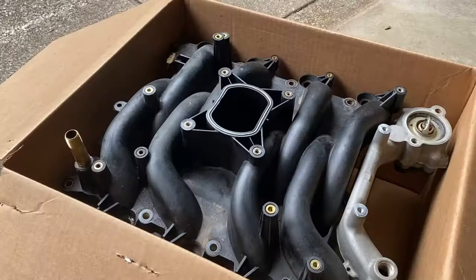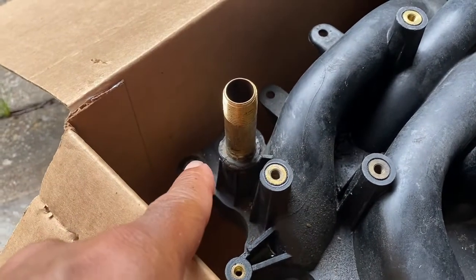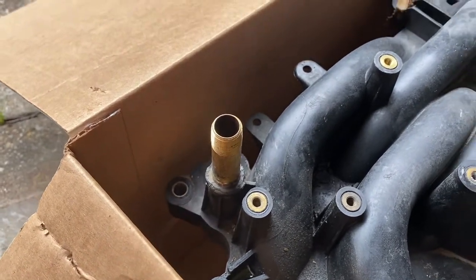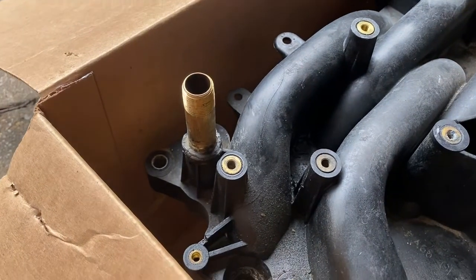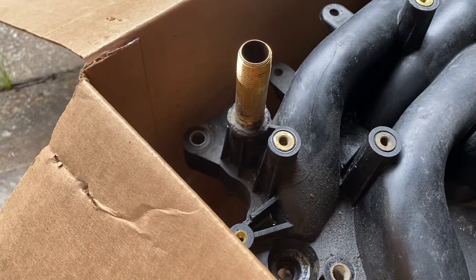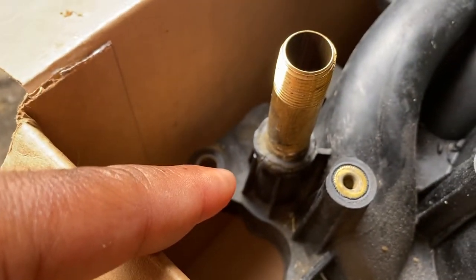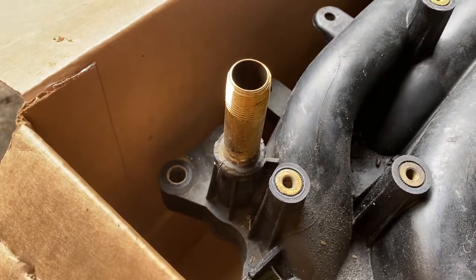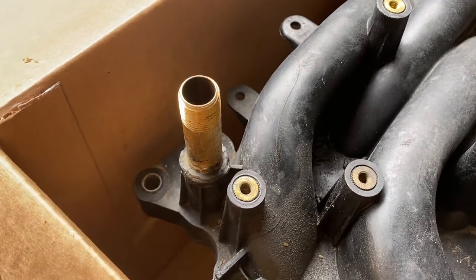I'm going to show you just what went wrong with my old intake manifold. So what you see here is my old intake manifold. As I showed you in the last video, I tried to thread in a male-to-male 3/8 insert into that, hoping it would fix it. I actually backed that up with some sealant and JB Weld, hoping it would seal. But if you look closely, it actually split down the side, so when I went to start the car it was spewing antifreeze from that spot. I knew that wasn't going to hold.